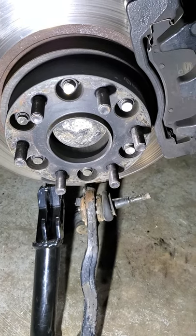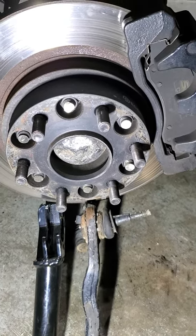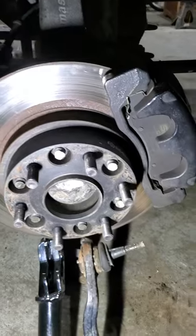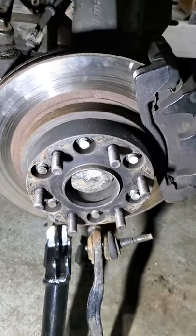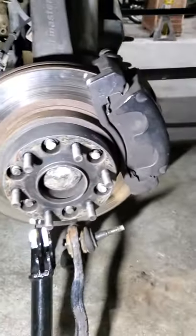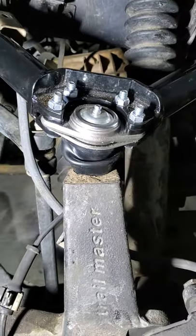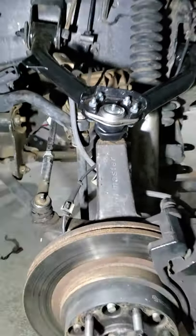All the way around — brand new tires, some Radar Renegade MTs. So that's why I have these spacers. They're one and a half inch spacers. I don't know the brand — I bought them used. As you can tell on this one it looks more pushed in, more of an angle slope, which hopefully will let me run my twelve and a half inch wide tires so I can take off these spacers and stop messing that up.